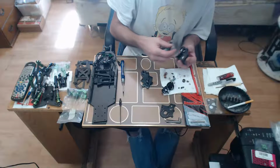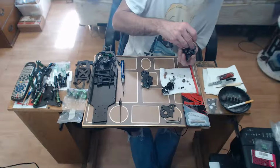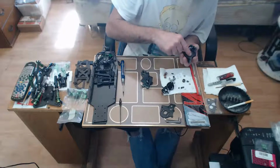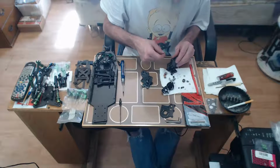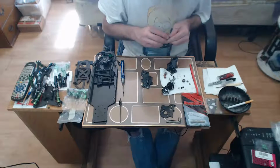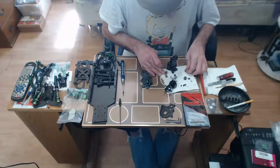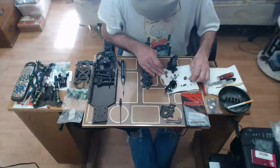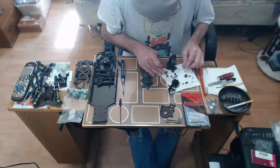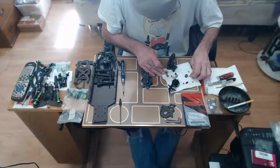So I don't want to get in there. We are going to shim that little baby and make sure that one gets done, because that's easiest to do right away first with nothing else in there. This off. That's a thick one. I want one that thick. Here we go. These two thin 4mm Teflon normal shims from Traxxas will be just fine.